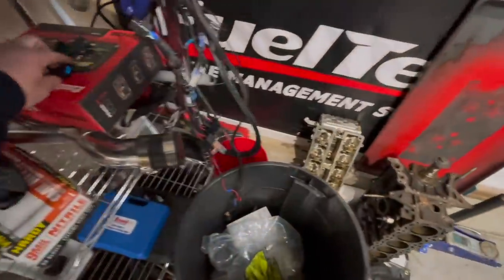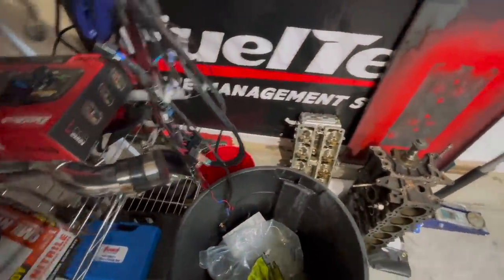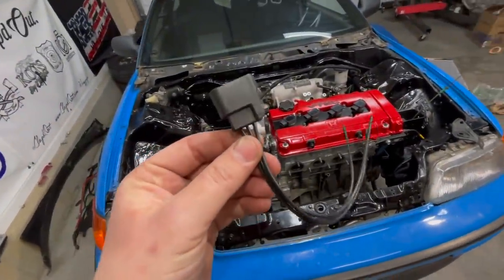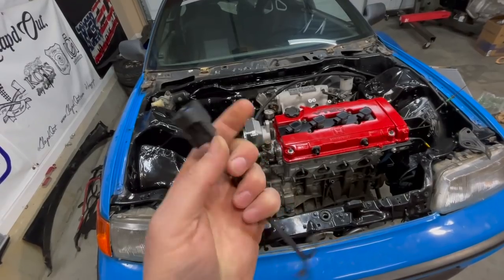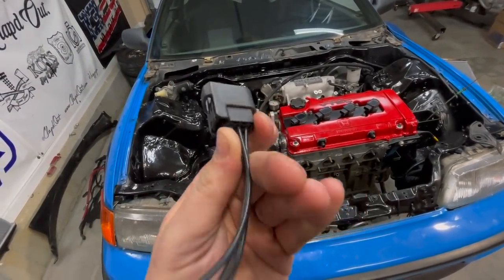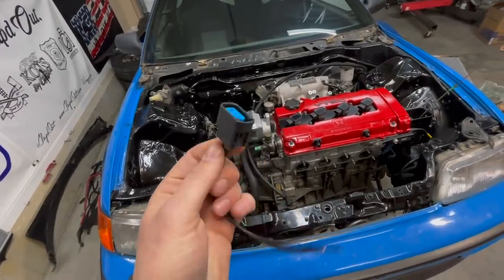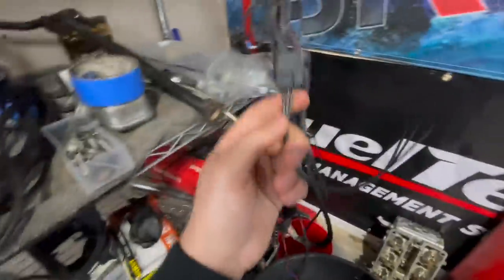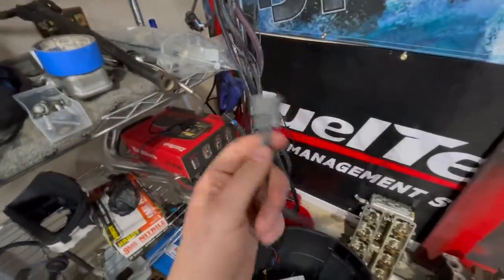I'm a little bummed because I bought these coil pack connectors. I thought I ordered them as plugs and pins and connector, but I hate eBay plugs like this because they're usually never crimped all the way, and I guarantee this is going to give me problems. So I'm going to reorder these with just plugs and pins so I can crimp them myself instead of butt connecting them into place. I say solder like I would ever solder — I just butt connect.